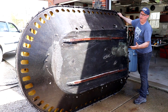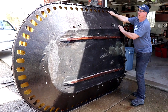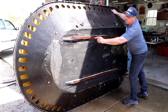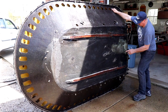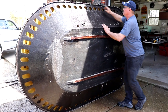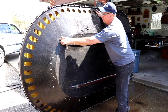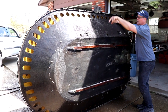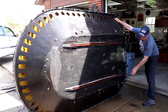I'm glad I took everything apart — and of course, who wouldn't before you set this on the water? But these stringers — these are just caps they put over top of wood stringers, and I'm going to replace those. In looking, there's a couple of spots like right here — looks like there was a repair here. These rivets hold the clips that hold the skirt, and all that comes in the kit when you buy it, so I'm not worried about the clips or the skirt.